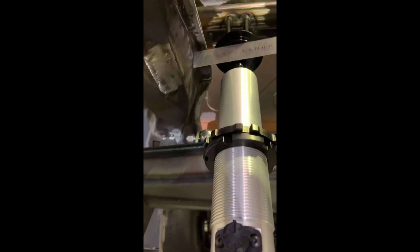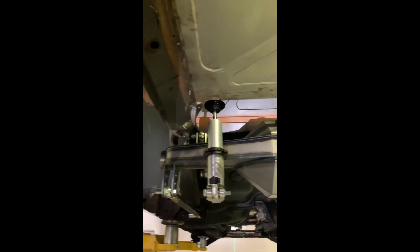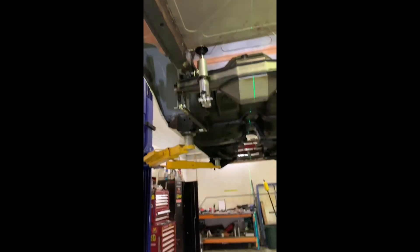At the top here we're about 32mm off the chassis. Going to the other side with exactly the same measurement and I'm around about 70mm. That's sheerly because the chassis rail is kicked over on the passenger side. You can even see on these — they're not even the same shape. You've got a triangle rail on that side as opposed to a square rail. Don't just assume your chassis rails are centred because they most certainly aren't in a lot of cars — some are, some they aren't. We'll take a quick walk around to the Torana and you'll see exactly what I mean.